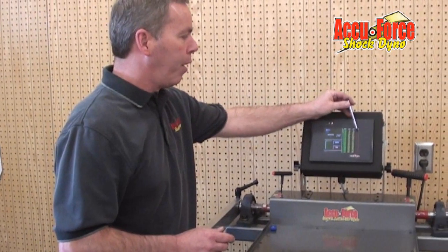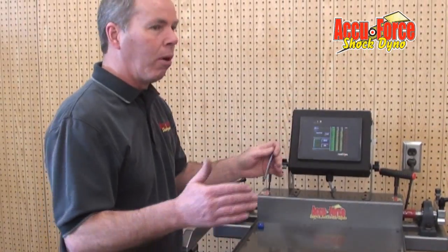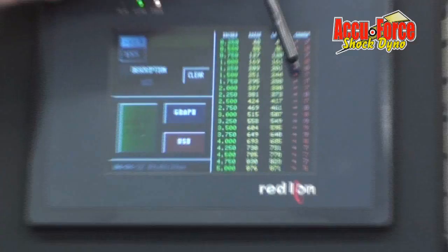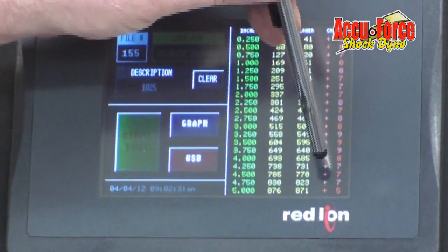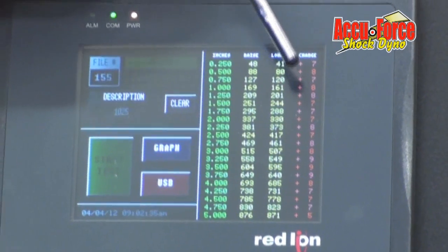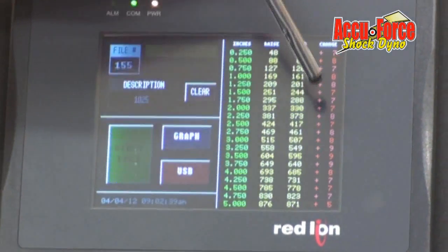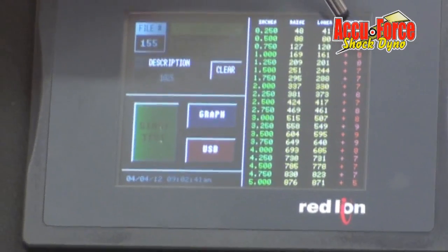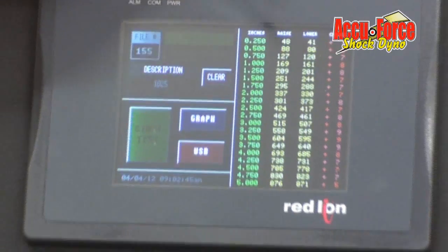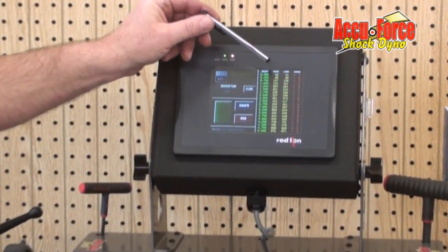Usually the lower the number is down here in the bottom and on both ends, the better. If it started out at 4 or 5 and went up, like this particular bar goes 7, 8 and back down, it would be a really good bar. This particular bar is a good bar. It doesn't get any high numbers, or the split never goes into the teens. It started out fairly low. It's a good bar, not a phenomenal bar at this point. It's a used bar.